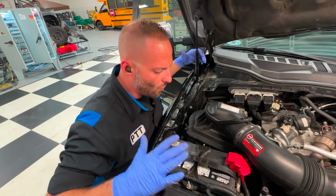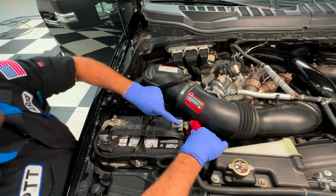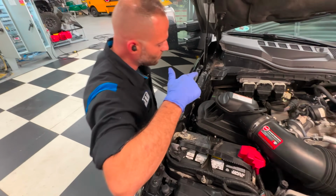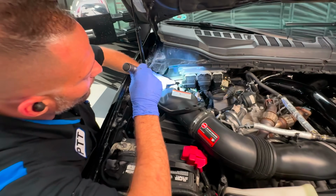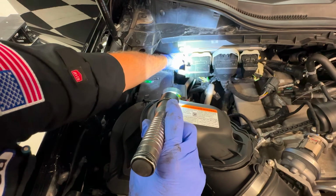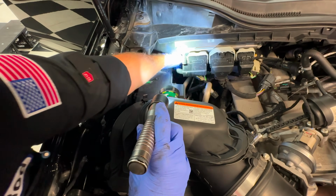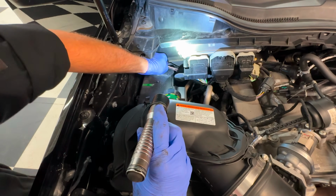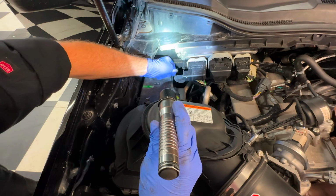So if you guys are gonna want to come and start on the passenger side, here's our 12 volts, okay? We could fabricate a little harness. Now we have to go in the truck. You guys look, some are not in this position, but I can actually see them right here. See these wires right here? These are our pass-through wires. I'm pulling it out of the tape. It's taped around the harness. All right, these are 4 circuits that the good people of Ford Motor Company leave us.